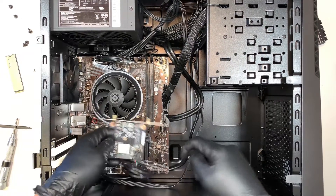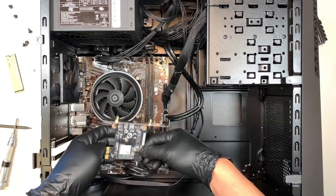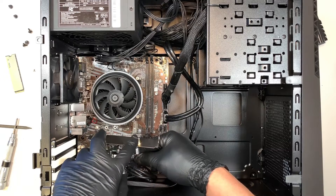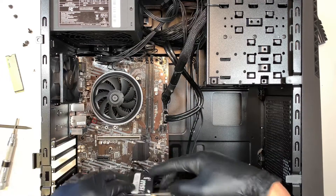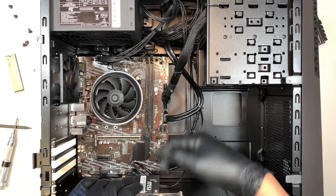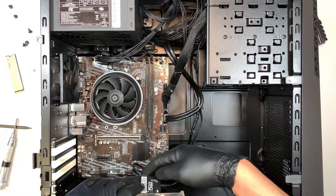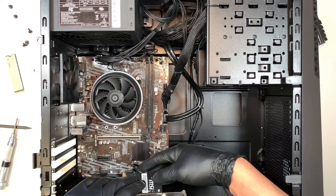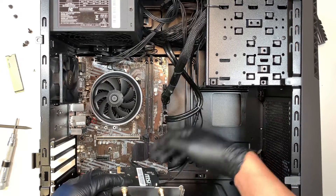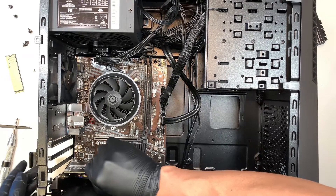Alright, let's put the SSD to the side. This is your Wi-Fi card — it has built-in Wi-Fi powered by a little PCIe Wi-Fi card. I'm pretty sure it comes with two antennas. There's not much room on this motherboard to add more components — it's a small-size motherboard, and the northbridge heatsink is very small too.